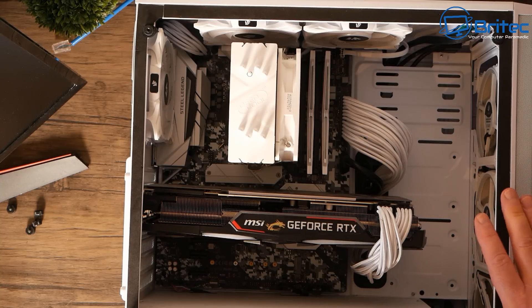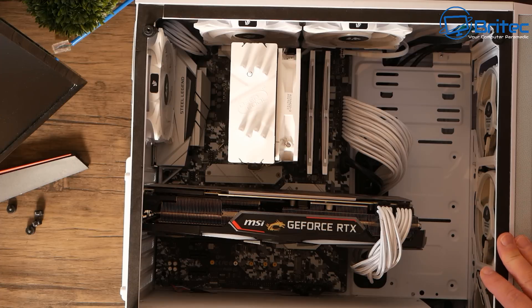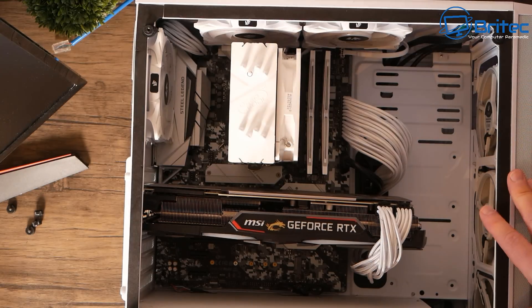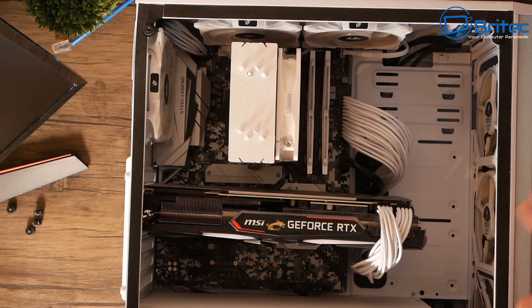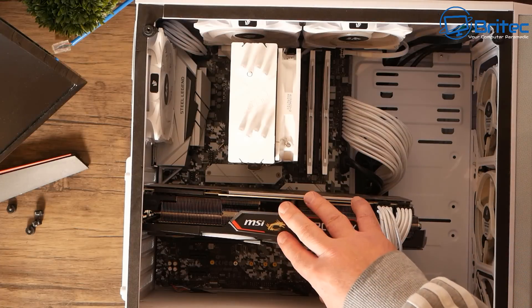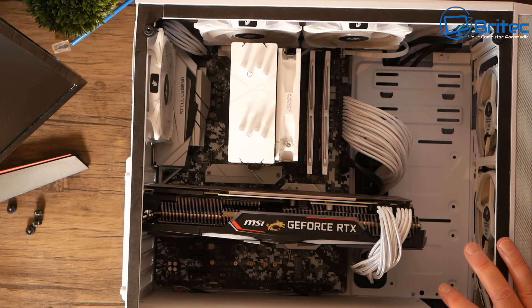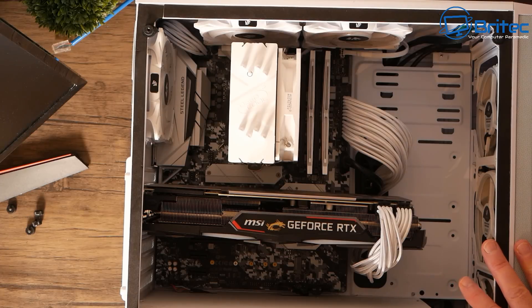As you can see we've got a pretty nice looking PC here. This could be due to the power supply that's failed, and if that has failed it could have taken out other parts on the build itself. I've tested the power cable that came with the PC and that is working perfectly fine. I tried another power cable and the PC is completely dead - there's no lights coming up on the motherboard, no diagnostic lights showing on the board at all. The quickest and easiest way to test this would be to get another power supply and bypass the one that's in the computer.